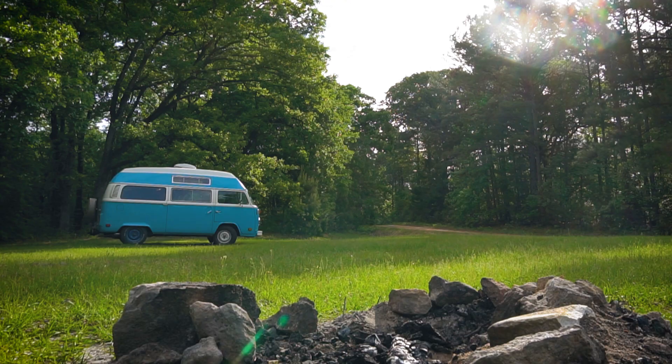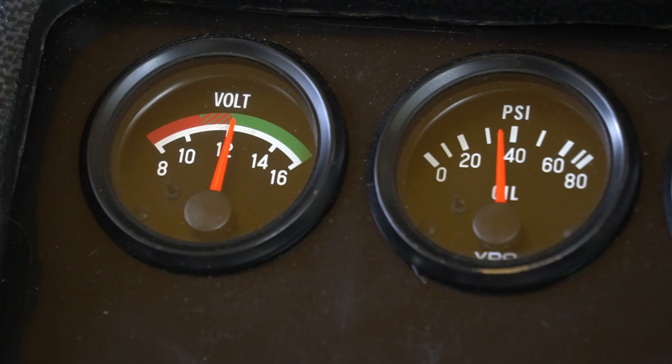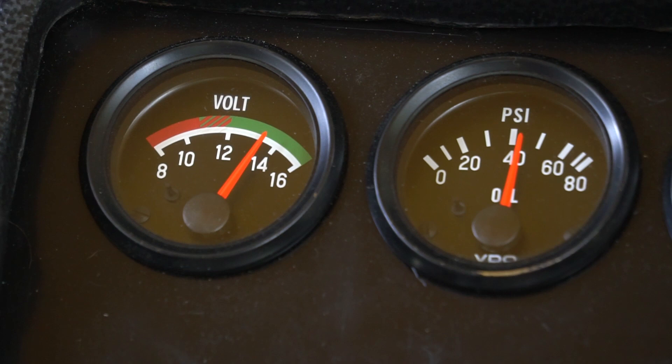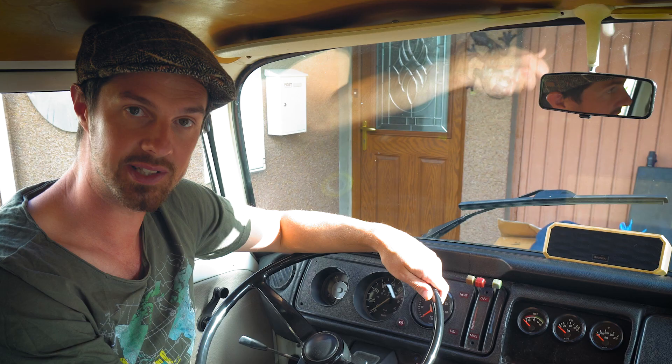This voltmeter is not the way to see your state of charge, and here's why. Imagine you spent all day off grid depleting your batteries to 50%, then took a five-minute drive to the shops. The alternator charged at 14.4 volts, you turn off your rig, and the voltage slowly drops to around 13.6 volts — great, the battery's charged, right? No. You have to have your batteries resting for about 24 hours before you can truly see what the state of charge is. This is a very inaccurate method, and if you've got a lithium system you absolutely can't use a voltmeter to see your state of charge.